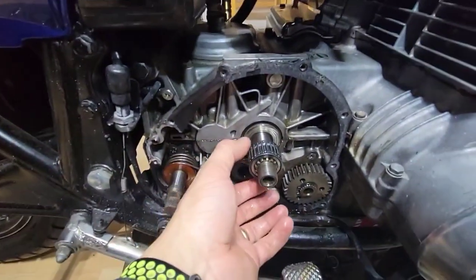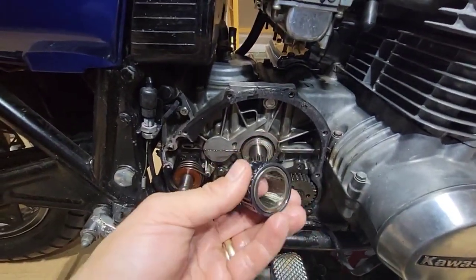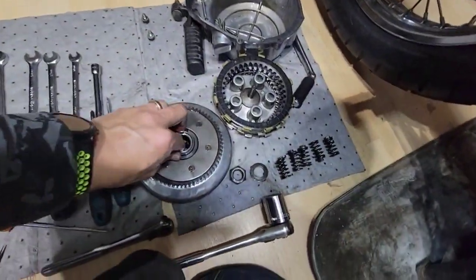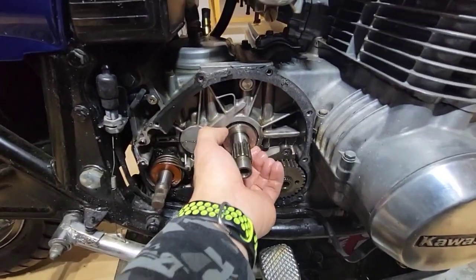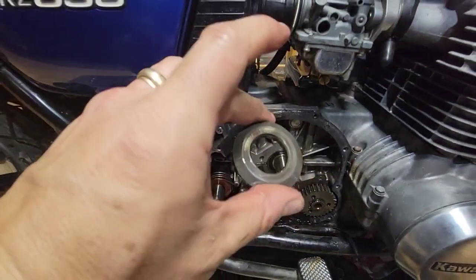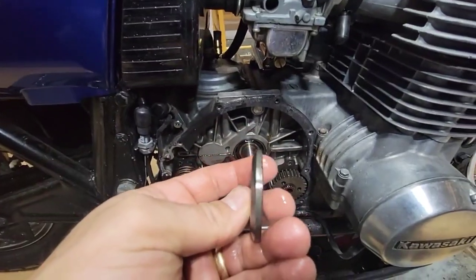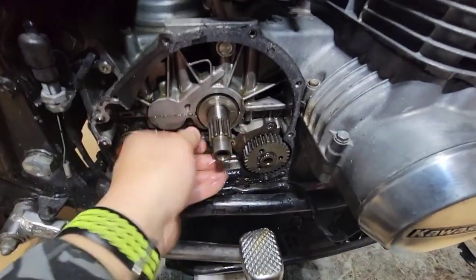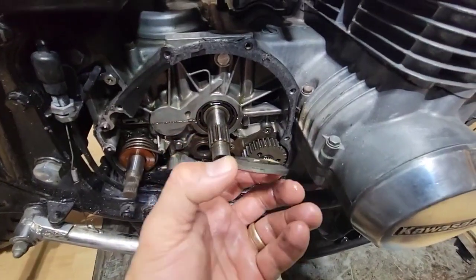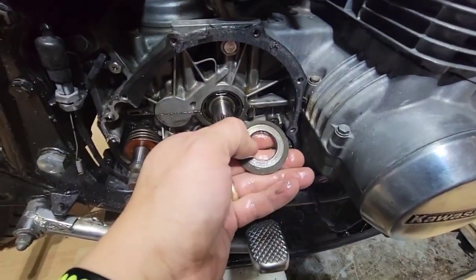And also here, this bearing, I replaced it last time that I bought it. It has a bearing and a bushing. So both of them, I will keep them here inside. See? We want to keep everything. And then we have another washer that goes directly to here. And this washer doesn't have an outer sign, but it does have a shape, so be careful with this. It came like this. What it's trying to do is to be flat here where we have the contact, and the angle is in order to make contact with the bearing. So now it's here as well.